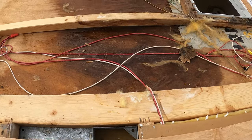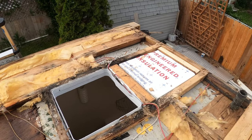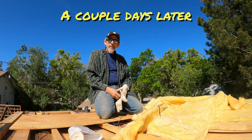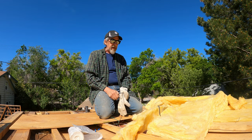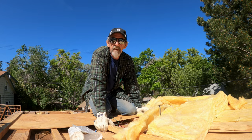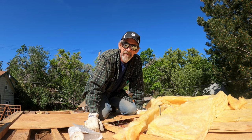It's not looking so good back here. We actually have water standing on this roof — I hadn't noticed it inside. It's pretty rotten over here. You can see this had rotted out before and someone had done some kind of a patch on it. We're going to fix it right. I've got my work cut out for me but I'm not too worried about it. I'm back up here now finishing cleaning up all this insulation so I can get a look at the rest of this roof. I know there's some really bad rot right over here. When I was putting the tarp on it, I was breaking parts of the roof off over here.